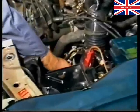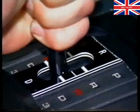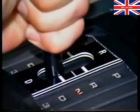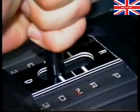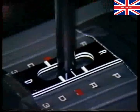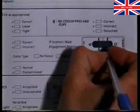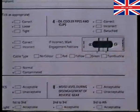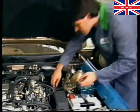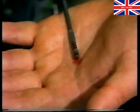Next, check the security of the oil cooler pipe connections. Now use the selector cable overcheck plate to determine the engagement positions for reverse and D4. If the cable is maladjusted, don't correct it — simply mark the results on the illustration provided. Also make a quick check on the selector cable type and colour code and tick the appropriate box on the report form. Then remove the gearbox dipstick and check if the transmission fluid is discoloured or contaminated.